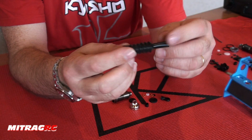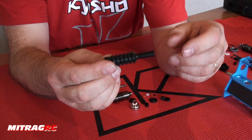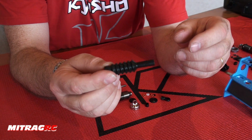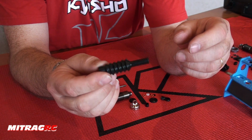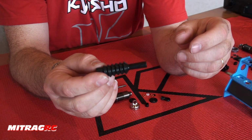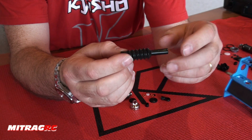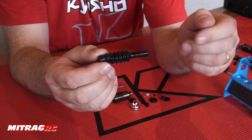Using these bladders or bellows, whatever you want to call them, is a must really, because this is what causes the damage to your shock seal if this is not airtight or relatively airtight to keep the dust out. So it's important for the longevity of your shock and the oil. When you see you've got grey oil, this means something's wearing or dirt is getting inside of it. If you open the shock and you have a nice bladder and the bellows are good and everything's clean, you know that no dirt's getting inside and your shock is operating perfectly.